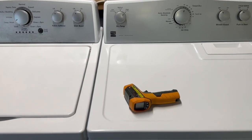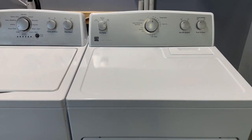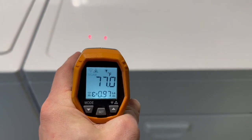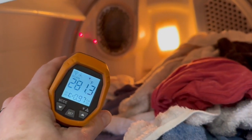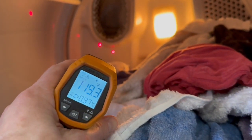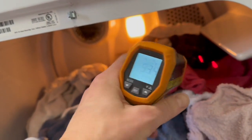I'm going to let it run for a minute and show you it's in fact heating like it's supposed to. You can see inside — sounds great, nice smooth operation. With my temperature gun aimed right between those two red dots, it takes a surface temperature measurement. It's 77 on top of the dryer, 60 on the concrete floor — colder down there. When I open it you'll see everything's tumbling and the heat comes out of that little vent right there. That vent heats the inside of your dryer anywhere from about 95 up to 195 degrees, depending on how long it's been running and your heat setting.